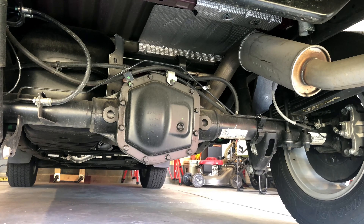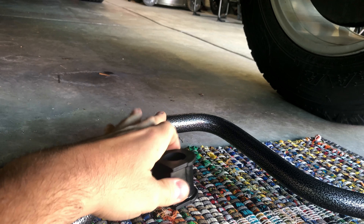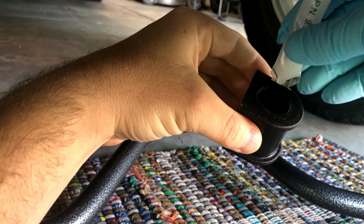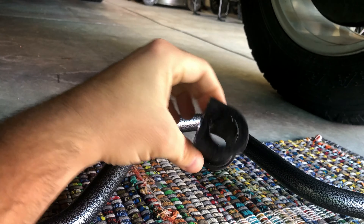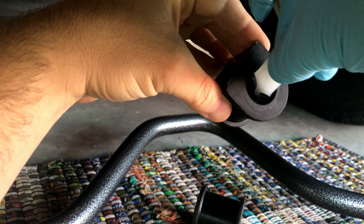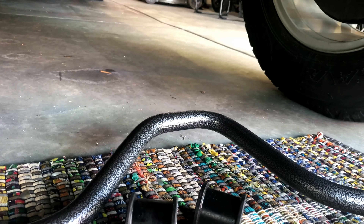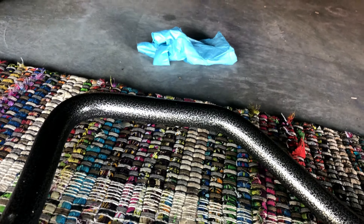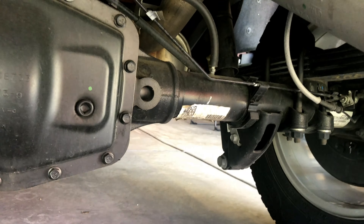This is the area we're going to be working in on the truck. You do not need to jack the vehicle up to install the sway bar — actually, you need the weight of the vehicle to be on the ground. One of the first steps is installing the D-bushings onto the shoulders of the sway bar, using the included lubricant. There are two shoulders: a narrower one and a wider one. The narrow section goes on the passenger side and the wider section goes on the driver's side.